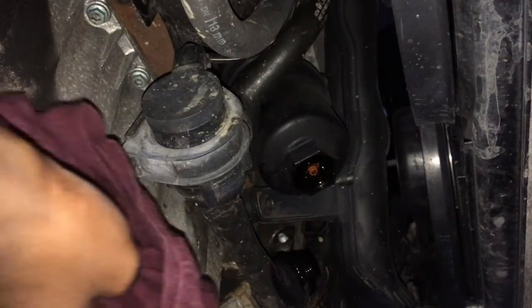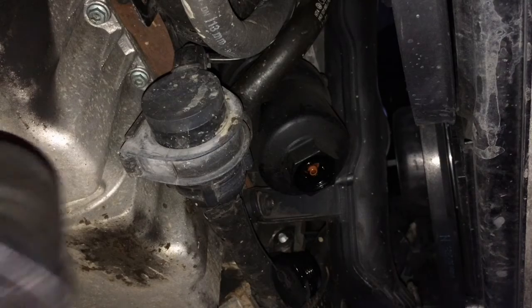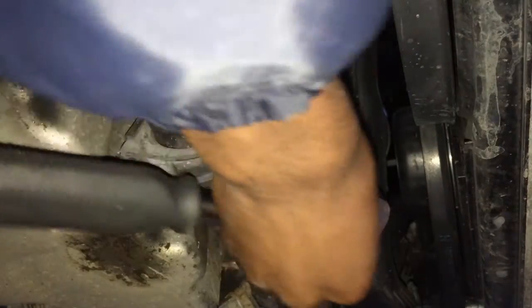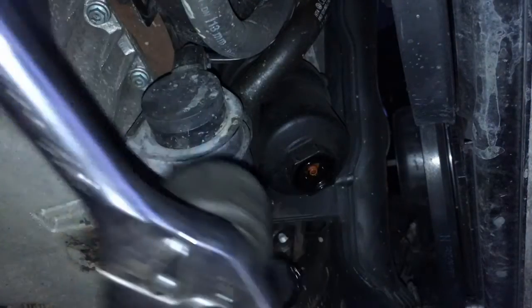So you can see there, I just popped that thing back in, so you can see the valve is now back in to stop the leak. So now, hopefully when I take it off, not too much oil will drip out. I've got my 36mm socket, and my ratchet set up the right way, anti-clockwise. I'm going to whack it on, hopefully it fits. Boom, it does, and I'm just going to undo it very, very gently. But you don't want to break it, so be a good boy, go and get an extension and come back.